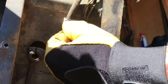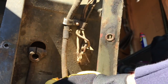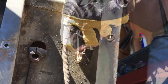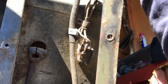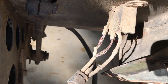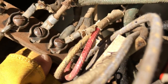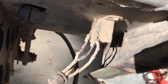On the upper side of the floorboard on the outside you can see these two little retaining clips that hold the wires going to the high/low beam switch and the wire going back to the rear tail lights. I'll go ahead and remove this switch — putting a screwdriver on the inside of the tub to remove the nut — then remove the clips so this big wiring harness can be dropped down. The leads from the switch are connected to the junction block and the one power lead that went to the main light switch.